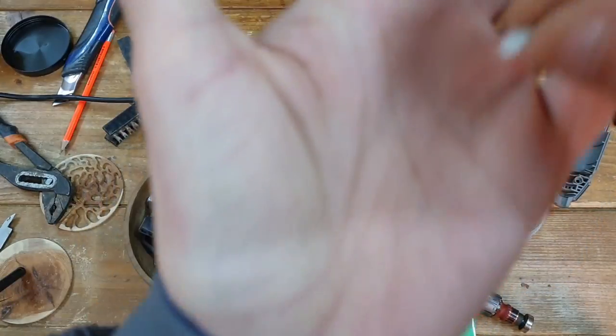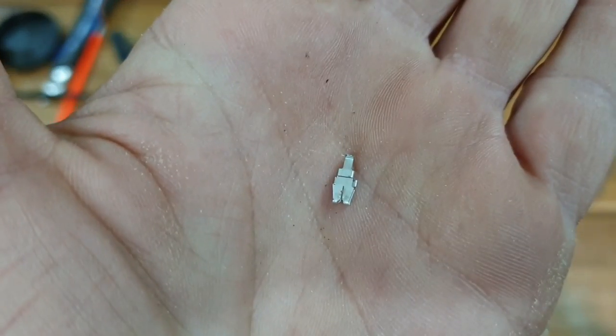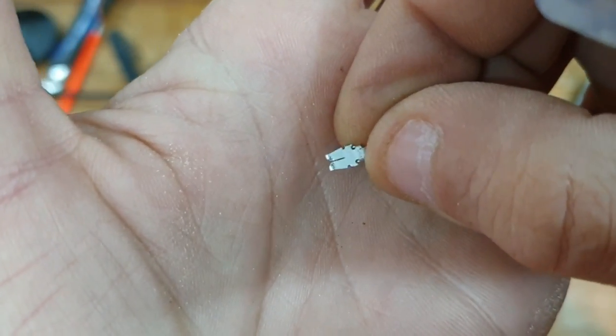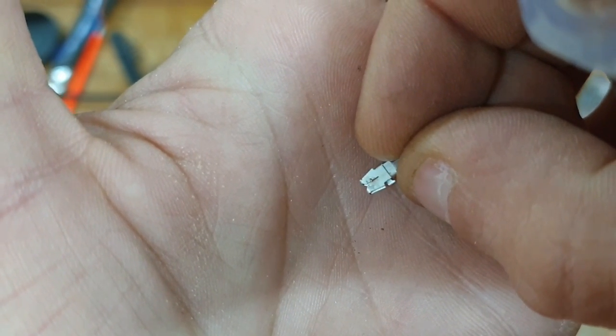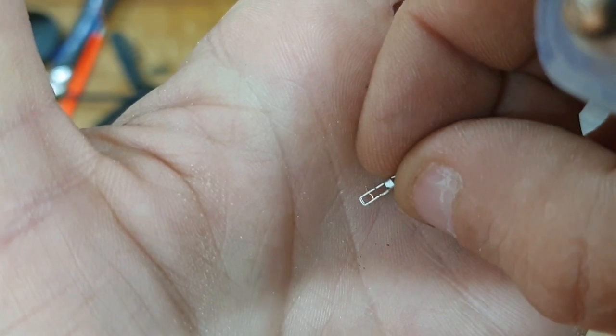This is the little clip I removed from the Dremel. There is a little piece of wire sticking out and this is where the wire broke. I'll just re-grab it in this little slit and push it back into its seat, and that should fix the problem.